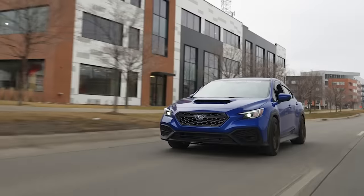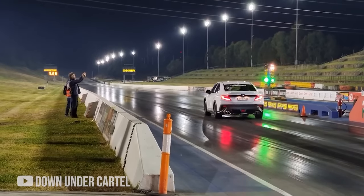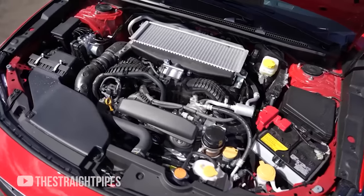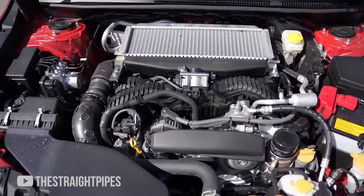It's going to come down to having a good relationship with a shop and a tuner that you can trust if you want to push your car to the absolute limit. Most of the shops are doing this for their own research or setting their car up for a drag pass, so you really don't want to leave your car tuned to the ragged edge at 450 horsepower. It's pretty crazy to think the FA24 can make that type of power on a stock bottom end, but it also goes without saying that you're going to start bending rods and breaking transmissions at this power level — so launches and really aggressive driving are pretty much out of the question. Hopefully you found this mod guide helpful and I hope I saved you a little bit of money, because if you just randomly buy parts expecting certain results, sometimes it doesn't always work out. It's always good to have a plan in mind, and starting out with a Cobb Accessport is going to allow you to custom tune your car and accommodate for different bolt-ons — so this is definitely a great starting point.